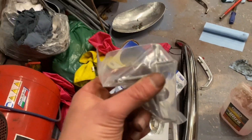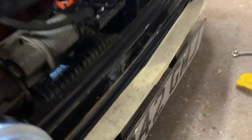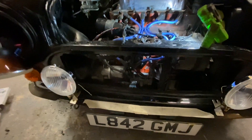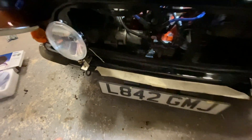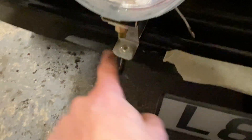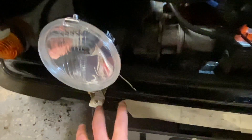I also have four brackets to mount them. First step was to remove the front bumper - nice and easy, three bolts from the underside, one in each corner and one in the middle just under the number plate. Next was the grill - pretty straightforward, just some Phillips screws. The mounting bracket fits on here - there are two pre-drilled holes. I think the inner hole is for driving lamps, but since I'm putting two fog lamps in the middle I've gone for the outer holes, which are slightly bigger.